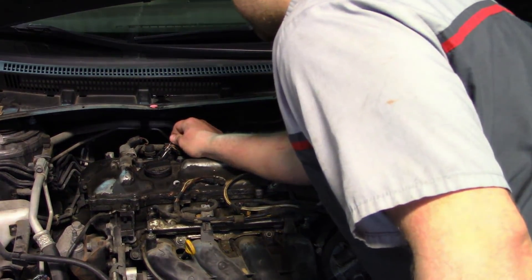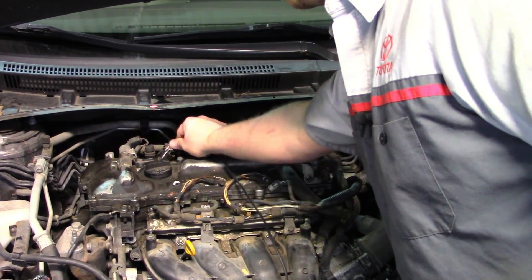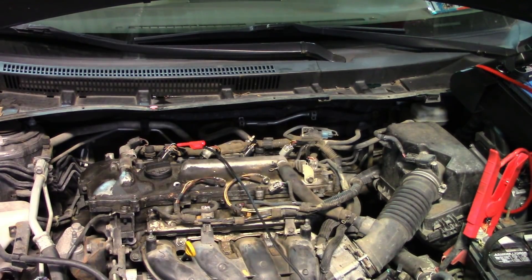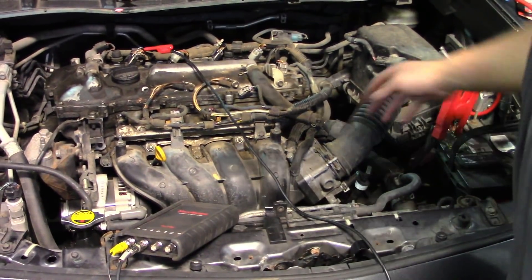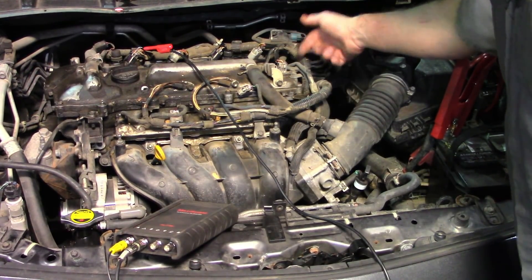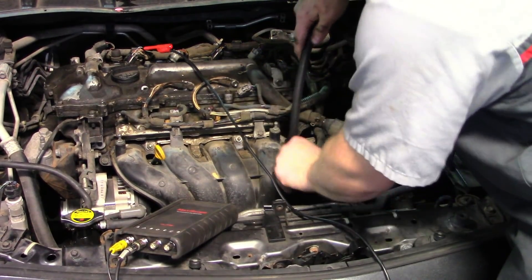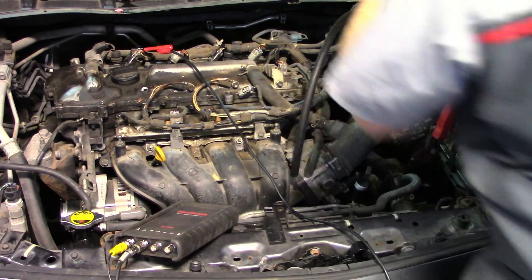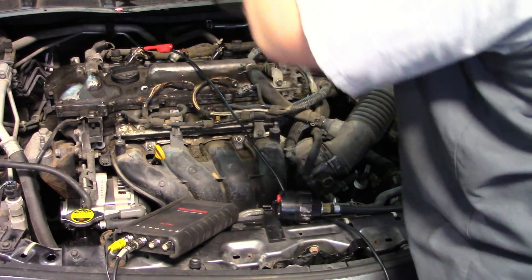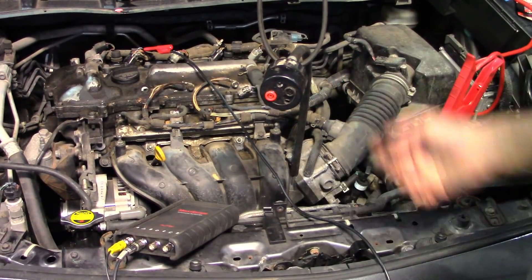Arrow faces the flow of current, right onto my negative battery cable. I'm going to back-probe here at the IGT — if you don't know what IGT is, I just made a video on Toyota ignition systems. This is going to sync our relative compression waveform to cylinder one, put on channel B. My purge hose is right here on the front — it runs from the purge valve at the back through a metal line. The purge valve is usually the best place to get an intake pulse from, and these sensors are so sensitive it's a good idea to hang them. Just the engine vibration will give you a waveform. Got this hanging up, hooking it to channel C.